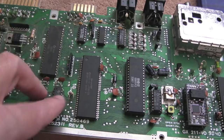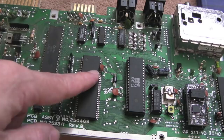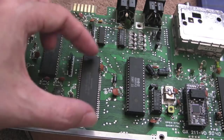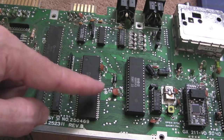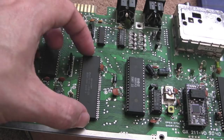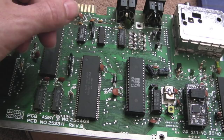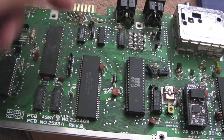It's strange how it's not causing any crashes and things, which would again point to the colour RAM being the issue - it just holds colour information. So we could swap that out. I've got a spare PLA from a previous revision that has the colour RAM separate. I looked at the pinouts and I think they're pretty much identical - the only difference is that some connectivity to that VRAM is not on this version, so those pins would probably go nowhere. In theory you could put one of those on here and wire in the SRAM externally, but that's a bit messy. I might just source a replacement PLA - they are quite pricey, 10 to 15 pounds, but I might just do that and swap it out.